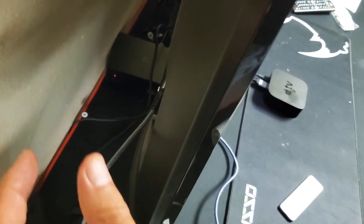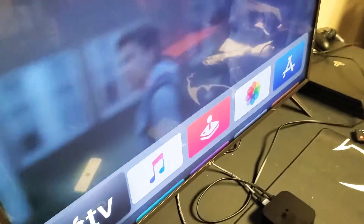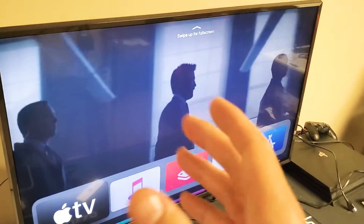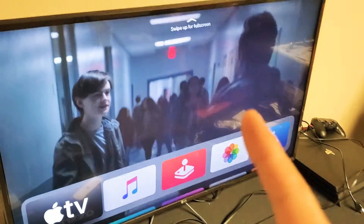So for this next step, it's possible that your HDMI port could be faulty, running hot, or have a little dust and lint causing an issue. What I want you to do is pull the HDMI cable out and plug it into another HDMI port, or pull it out and blow into it or use some compressed air to clear out any dust or debris. If you plug into a different HDMI port, don't forget to grab your remote and select the correct HDMI input — HDMI 1, 2, or 3. Open up YouTube and hopefully you're up and running. Turn the TV off and back on to confirm.